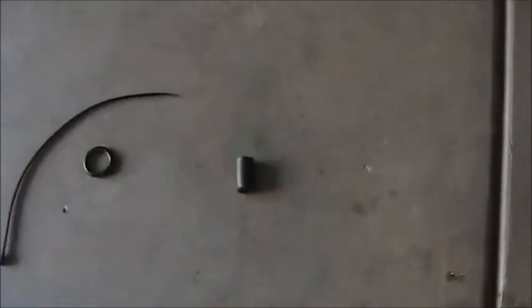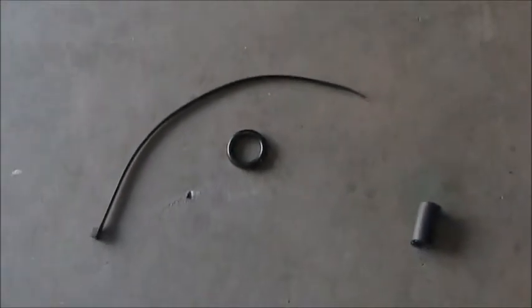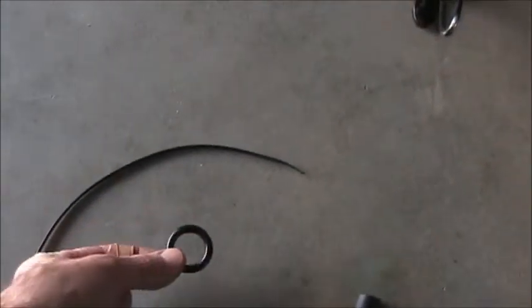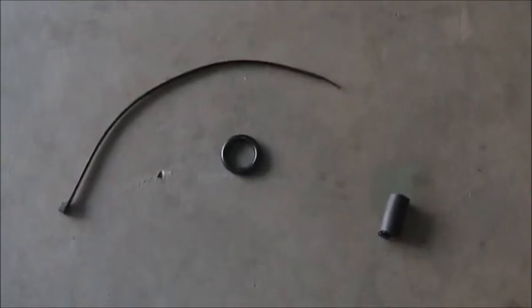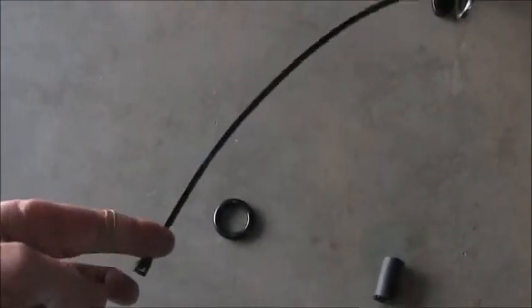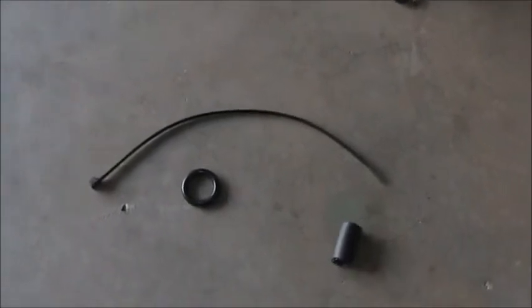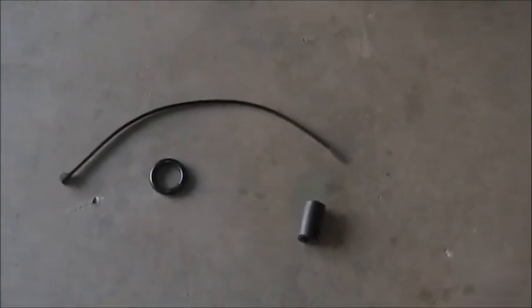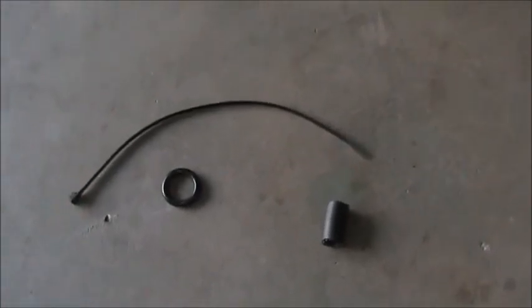For Bill: from the bypass tubing in the kit, I only had to cut 1.25 inches to make it fit from the thermobob to the bypass fitting. Here's the mystery part of the day — the small fat o-ring apparently is something needed for KLR and KLX kits but not for the 250. I also didn't use the zip tie included, as I have my own more rugged ones that don't even think about breaking. Anyway, that's the end of the project — it was good and I think it's going to work out nicely for the bike.